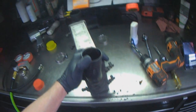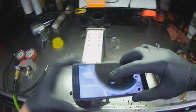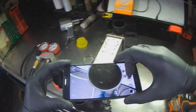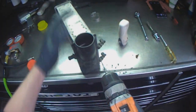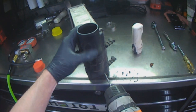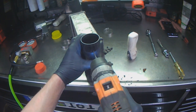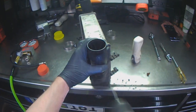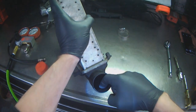This size hole you would never drill in your cooler — and even that one, I don't see any shavings in here. Take a picture so you guys can see and zoom in as much as you want. This will be my leak-down tester hole. Over here I'm going to drill a hole in a similar location as in the ALH's — I always pick a low spot. This hump is in the way so I'm going to go right here. I'm also going to put some oil in this thing later. Same thing in terms of debris — there might be one shaving here, stuck to the side. Another picture for you guys to dispute.